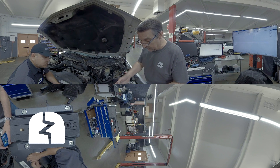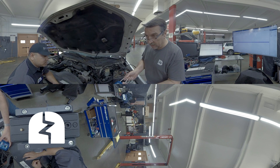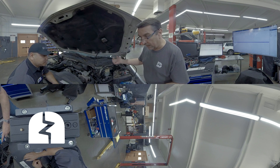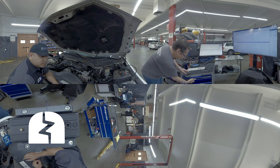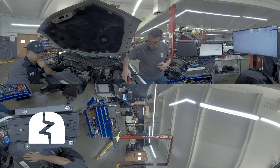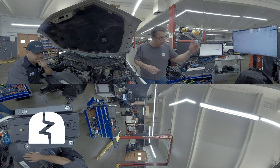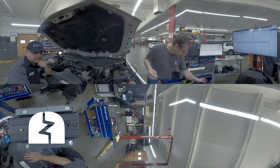What we're going to do is hook up the Pico scope. We're going to look at the load with the current probe. We're also going to look at the voltage — supply voltage — and we'll watch that and log it. So with Pico, we've got the Pico 4425 plugged in here. We need this current probe and we just hook it around here, but we don't know what the polarity is, so if our signal goes backwards, we can just flip this thing over.